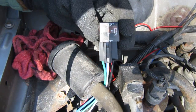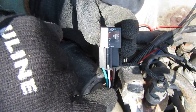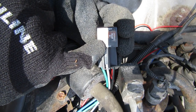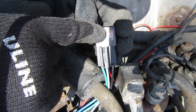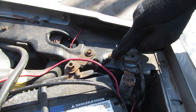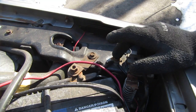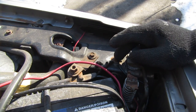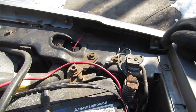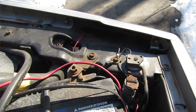You can see there's a little schematic on the relay. I took the 87 from my PCM cooling fan relay and wired it to 87 on here. I took 30 and wired it to 30 on here. Then I took another wire off of 85 for the ground — this is the body ground I cleaned up when I put in my Helolites. I've also used it for my winch controls. You could ground back to your battery if you really wanted to, or anywhere you know you'll get a secure ground. If you try to do something that's painted, make sure you sand down the paint before you attempt that.